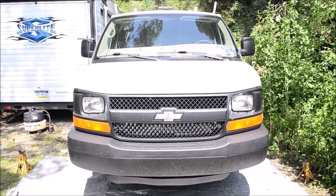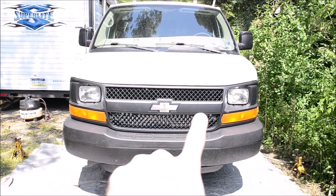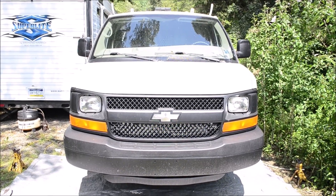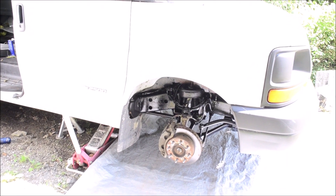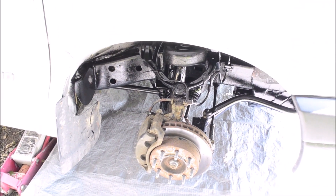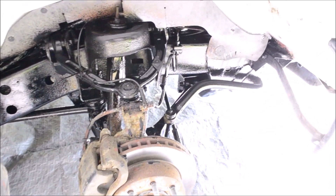These vans have serviceable grease points on the suspension components in both front wheel wells and on the steering components found under the front of the vehicle. You might also have Zerk fittings on the universal joints on the driveshafts. You don't need your wheels off to do this, unless you put it up on ramps or lift it up with a jack. However, I have mine off for some rust cleaning in preparation for the winter.